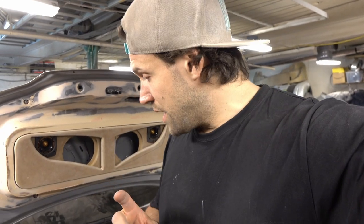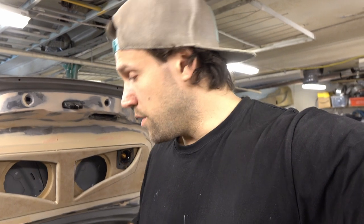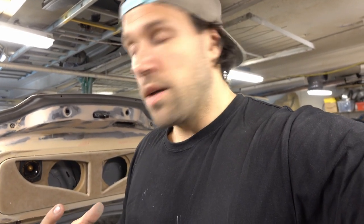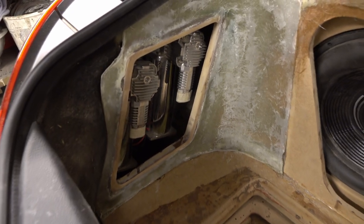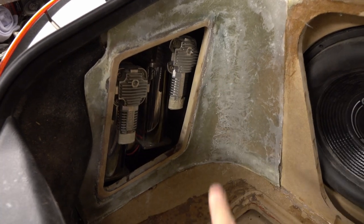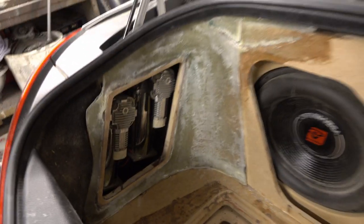What I've been doing is cutting everything after the resin and fiberglass cured on the back side. Now I'm going to mask everything off again because we're going to apply the bondo — and I always apply bondo in the car. For anyone new here: you should always have things in the car when applying bondo and fiberglass because when it heats up it shrinks, and if you apply it outside the fitment can be off. This is how it looks right now and I'm pretty happy — think of having plexiglass with a cool frame and RGB lighting in there, that's going to be really awesome.